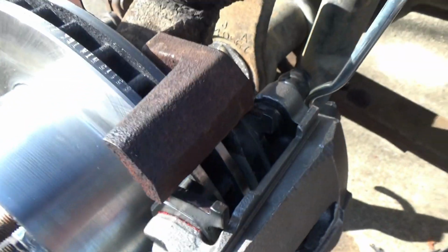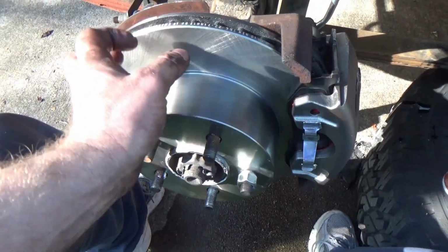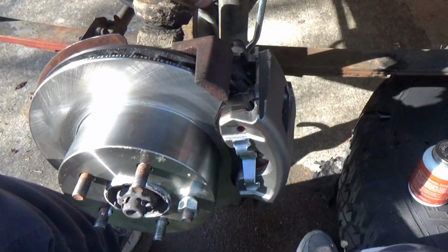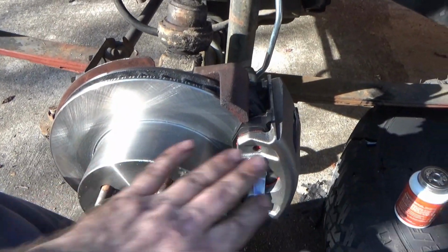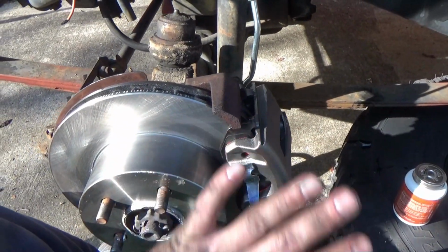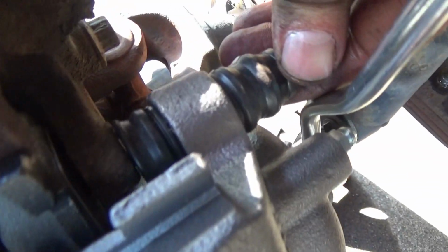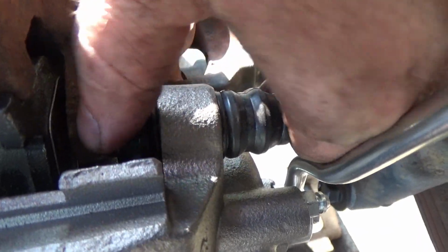And also, like back in my video where I do just brake pads and rotor, you may have to press that piston back, which you guys can refer back to the other video. Most of the time with brand new calipers, you don't have to worry about pressing the piston. But due to these things right here having those rubber boots, they will often want to push this way and get binded up on that bracket.